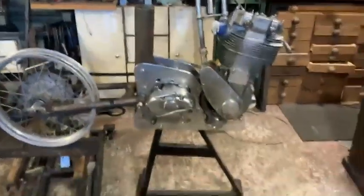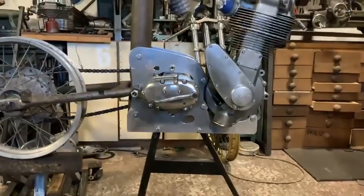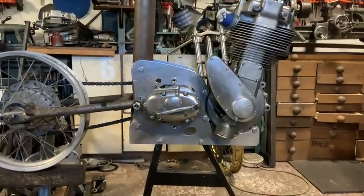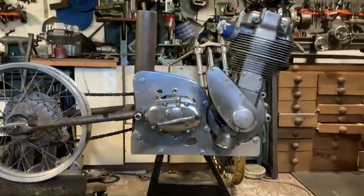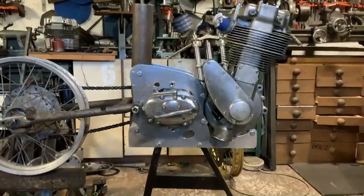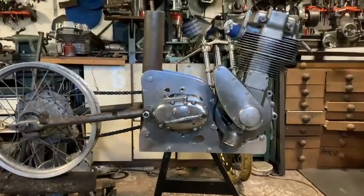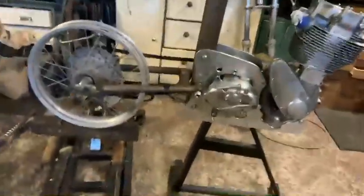On this particular build we've got a Nova five-speed gearbox in it, and I've made the frame and the engine plates keeping the angles as best I can. I'm leaning the engine slightly forward on this machine, and the engine plates are going to cradle the engine. Hopefully this thing should be in the right position — obviously you'll never know until you've finished it, but this is the basic project.